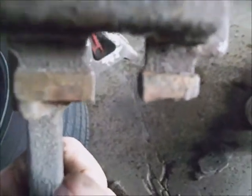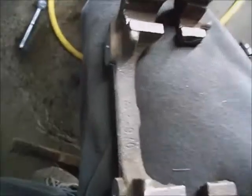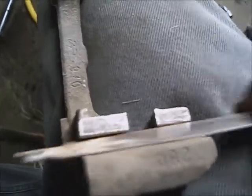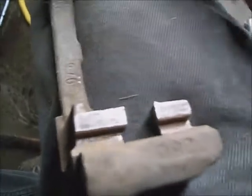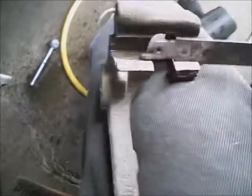I'm going to scrape all the rust off of that and kind of dig out those trenches a little bit with a file, just to square them up and clean them up and get the rust out. The Sawzall blade is great for getting in tight places, and since it cuts metal, it scrapes the rust off pretty effectively and quickly. You just want to get the rough stuff off, not really take any metal off the wall. Once that looks pretty good, make sure the new pads slide through without incident.